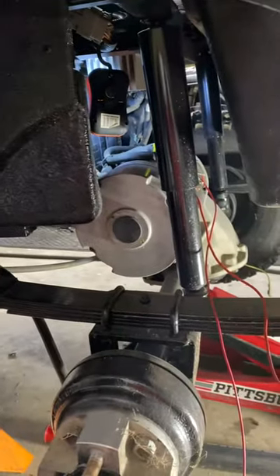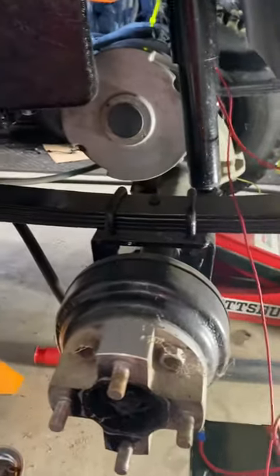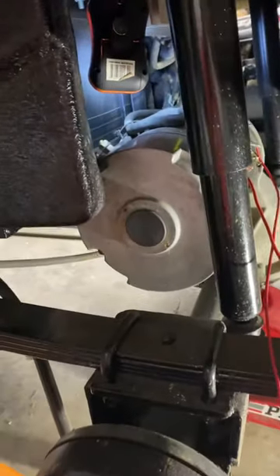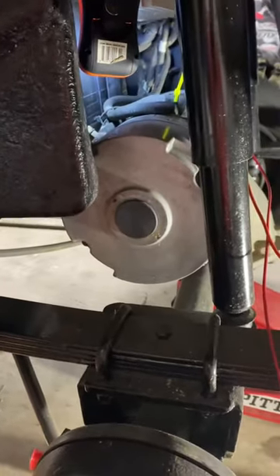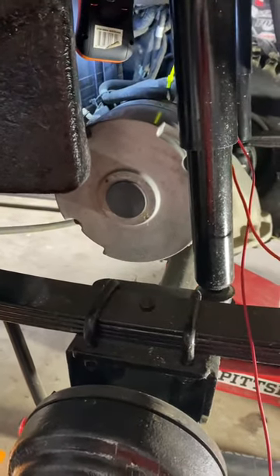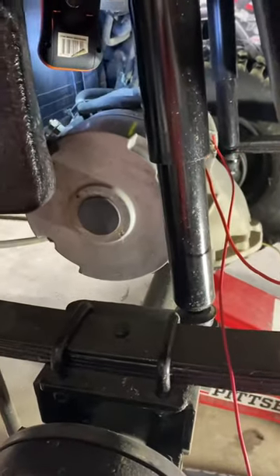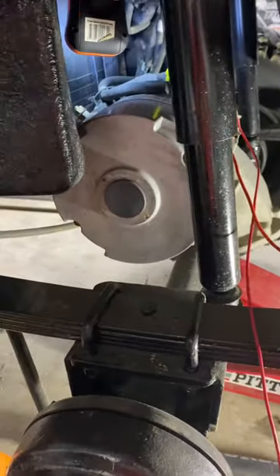All-electric four-by-four, motor in the front, motor in the back — testing the motor today. There are two types: shunt wound and series. Basically just try one way and if it works, good. I got this one right the first time, which is series. Here's the wiring diagram.